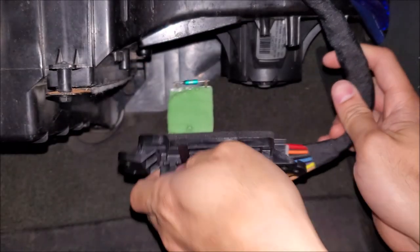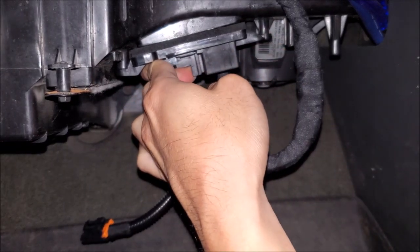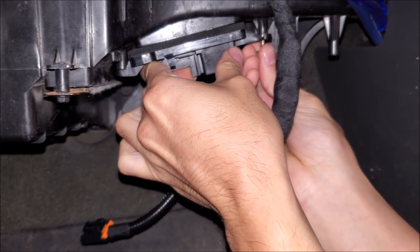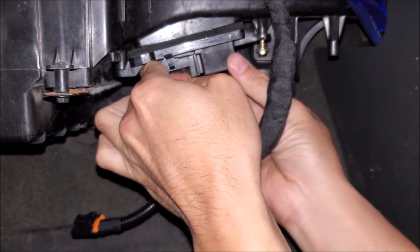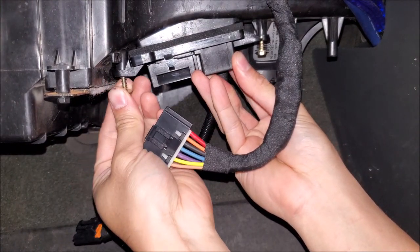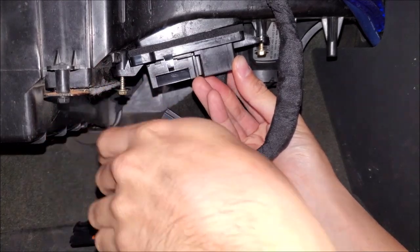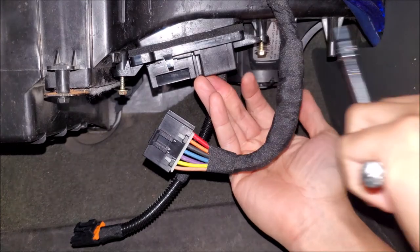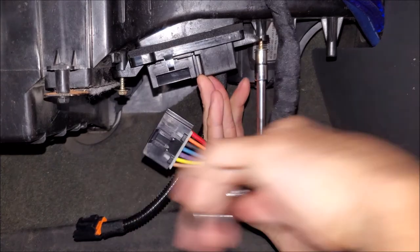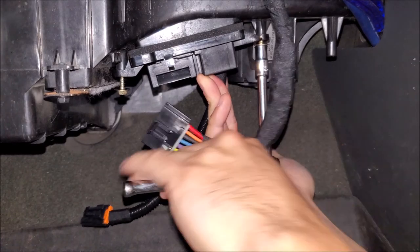All you have to do now is reinstall the new unit. If your plug is fine, you don't have to do this stage. But as preventive maintenance, the wires were a little bit thicker. At the end of the day, you're only as good as your bottleneck — so even if you put thicker wires on your pigtail, it's technically not a full upgrade because you still have to deal with the thinner wire from the factory. But at least at the plug, it's not going to get hot — that's really the issue we're seeing with age.